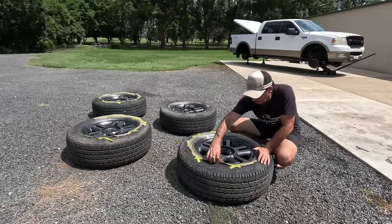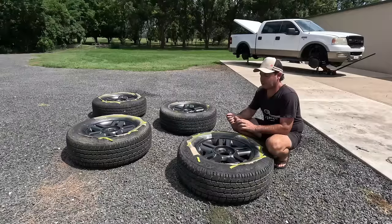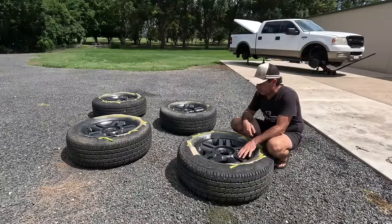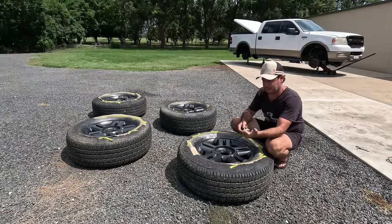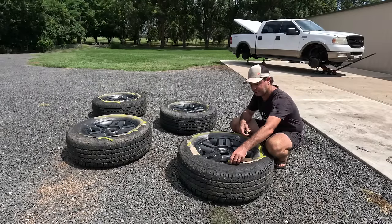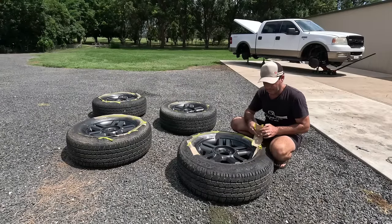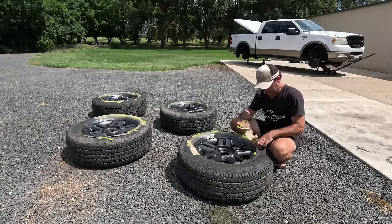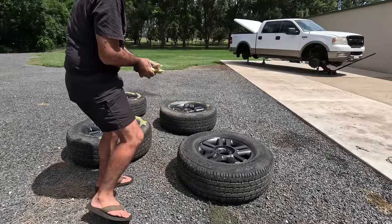And that's just an acrylic lacquer, which by painting standards these days is a little bit old school and dated, but I like acrylic lacquer on little jobs like that. Three reasons. It sticks well, it's easy to use, and it dries fast. Easy to touch up too, I guess, so maybe there's more reasons. I just like it, alright? How fast does it dry? Well, that's touch dry now. I reckon I'll give that an hour in the sun and then we'll put them on. That's the bit I like about it. No mucking about. Hell yeah.